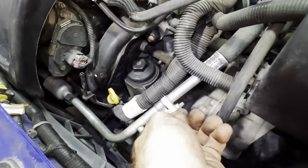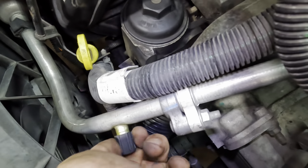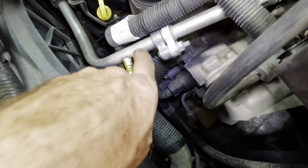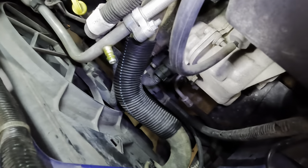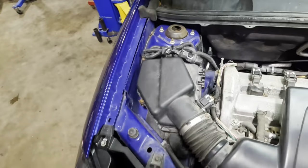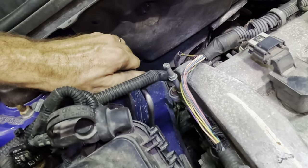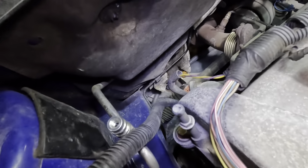Now, looking back on part one of this video, when we did the initial inspection, I found some green dye right here on that valve. I learned after the fact that this system was recently recharged and everything was all copacetic, but again, we learned that it bled out and stopped working effectively overnight or over like 2 days. So we're gonna get the machine on this, recover everything, see what's in here.